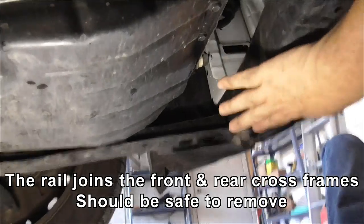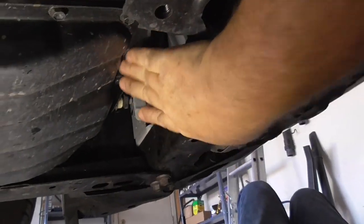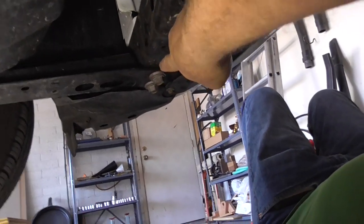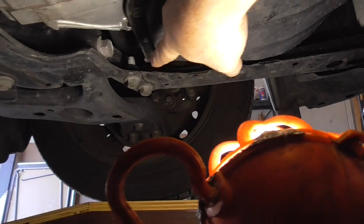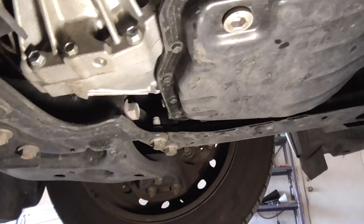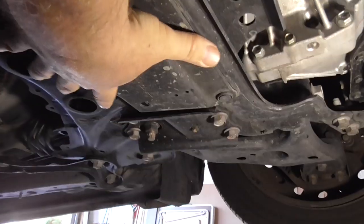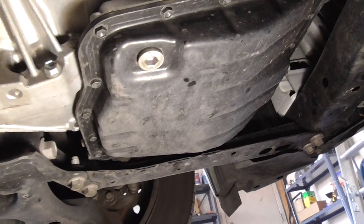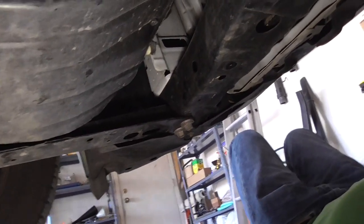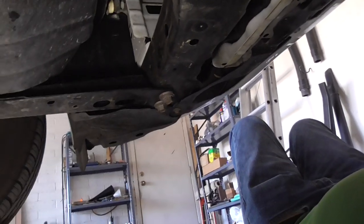We've got the plastic bit off that was covering this area, so that gives us good access to this front row of bolts on the sump. I'm evaluating whether it's a good idea to pull out these two big bolts here — here's the tight spot — barely get in and pull out these two bolts at the back. I don't want to change any steering alignment, so I think this is a subframe piece that I can remove without affecting the steering, which is very important. It does support the engine up front, but I'm not seeing a reason why I can't take that off.